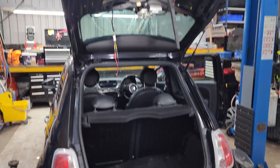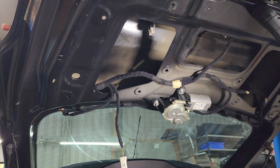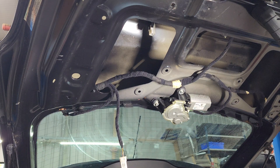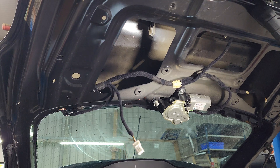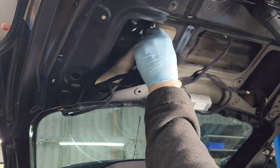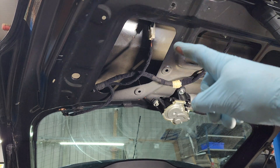Like I said, if you've got a bad button, chances are it's all in that unit. So you come under here and this cover is just a fabric one - a carpet liner. It is held on with lots of little holes with a plastic push clip through them; a simple trim tool will remove them. You can do them with a screwdriver, just be careful. Then you can do a quick test here and see if that circuit's good - if it is, that means the fault is inside that unit.